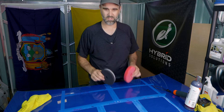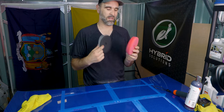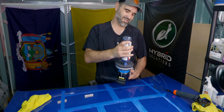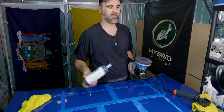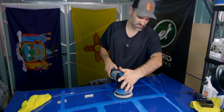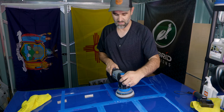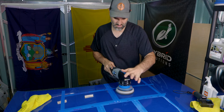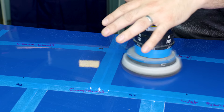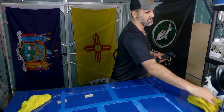For machine application, you can pick up either of these black or red foam applicators - these are super soft finishing pads. I prefer the black one; I've already got one loaded up on the machine. A beauty about using black is you don't know it's staining. Just a couple of small pea-size amounts - you don't need a lot, it's a very oily slick product. Let me change this to DA mode because that's what you guys will be using, and just go.